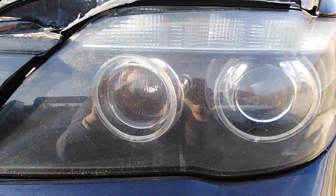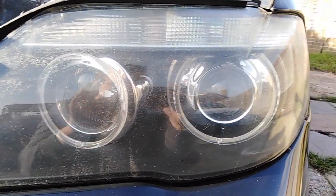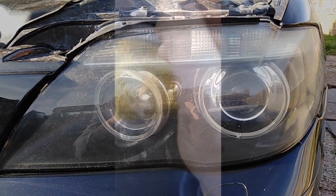Okay, I've used heat all the time when taking this one off, and that's the difference. You have to do a lot less work cleaning it afterwards, so best to use some heat. The quickest way to get rid of any bubbles, get a nice thin needle and pierce them, and then with a bit of heat just push out all the air and water. You're not going to see the piercings afterwards because the film will contract and it will look good.